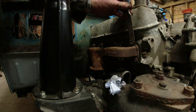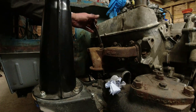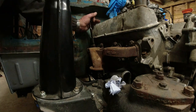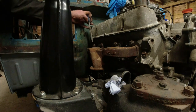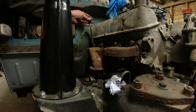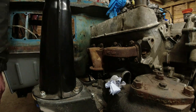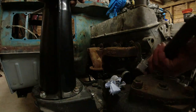If you don't do this, then you will find that the bolts loosen, and then you wonder what that ticking noise is, thinking it's your hydraulic tappets. Nope, it's the exhaust manifold gasket, because these bolts have undone. I've seen all manner of bolt kits out there, one with a hex head on it, and you think, oh, that's fancy. No, it isn't, because how do you lock the tab against it? Because it's round.